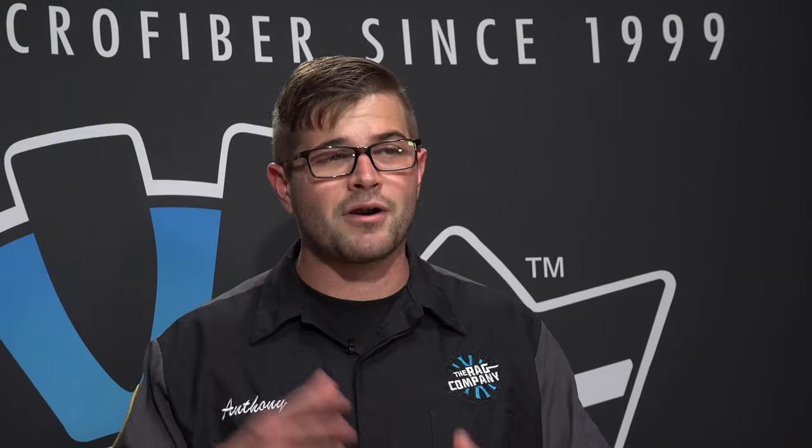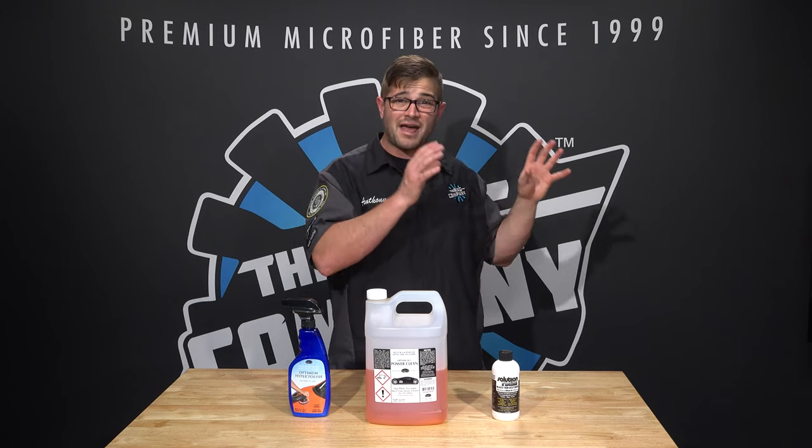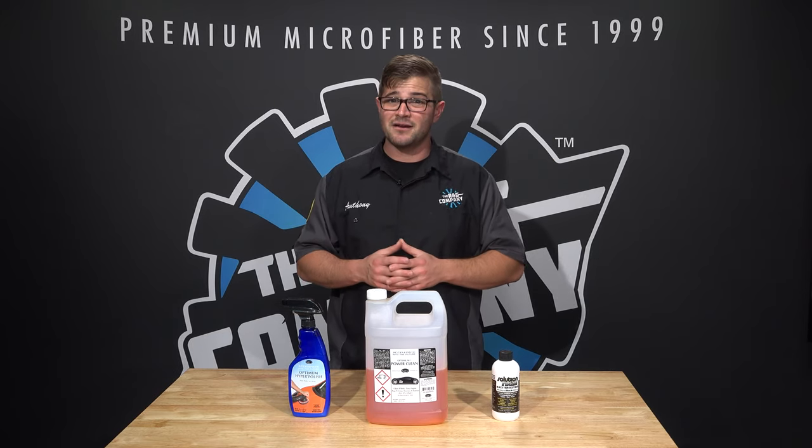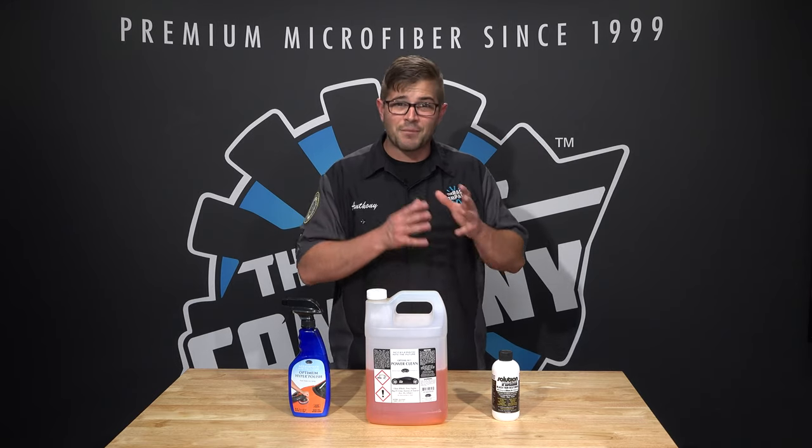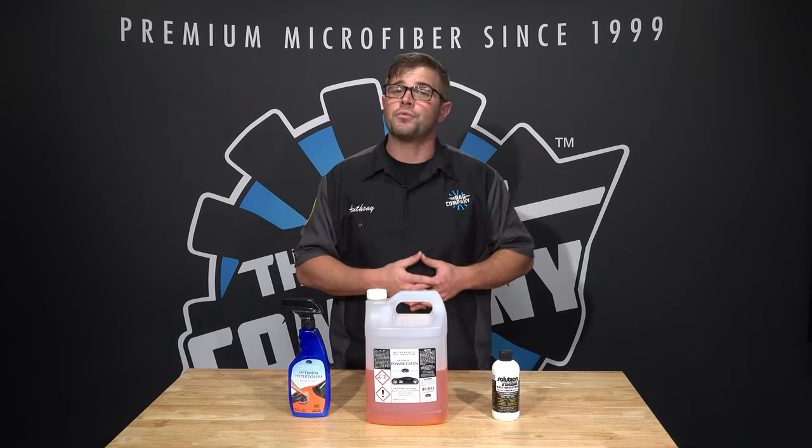Well, the reason why it turns white in the first place is because there are abrasives and there are also solvents within those compounds, waxes, polishes that you may have used that have caused that. So depending on how long they bake in the sun and stick there, they could be temporary or they could stick around forever. But I do have a couple different options on how to remedy that regardless.